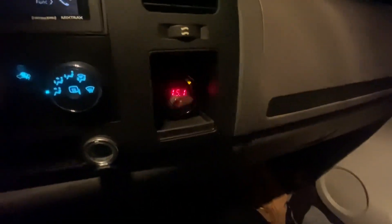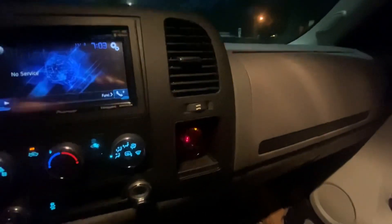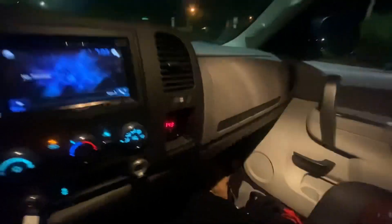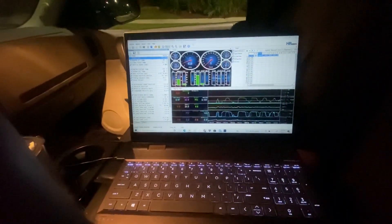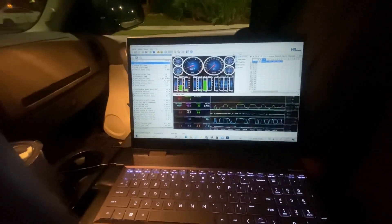What's going on guys, welcome back to the channel. I installed an AFR gauge on my black Silverado and it seems to be running pretty lean — and this is just at idle. I used a little pocket that was there; I didn't try to make anything too extravagant because I was kind of wanting to see what it would be. My friend Chad has helped me do the tuning on this, so we're gonna go through this because it wasn't very good, but we're gonna see what it does now.